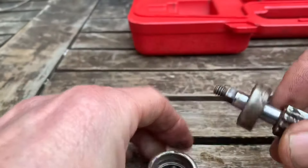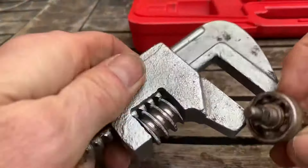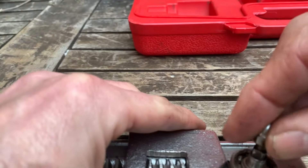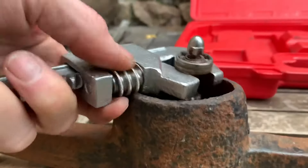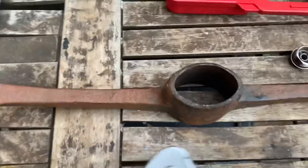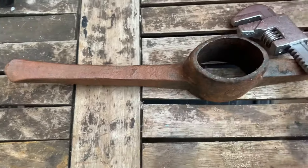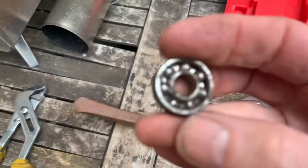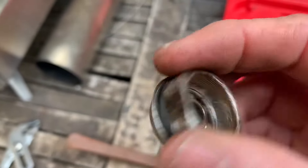So this will come apart like this, and this bearing still needs to come off — the ball joint press is just slightly too big to do that. So what I'm going to do is bash on top with a hammer, but before I do that I'm going to put the nut on there because I don't want to damage the threads. Now these bearings should be sealed on both sides. This one isn't anymore, which is why it's so rough and worn, and there's still a bearing in here which we have to tap out — so you'll end up tapping out two bearings.